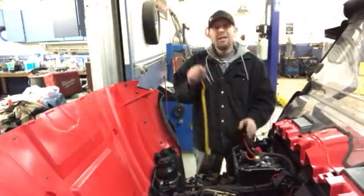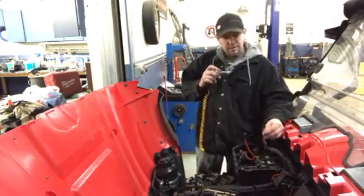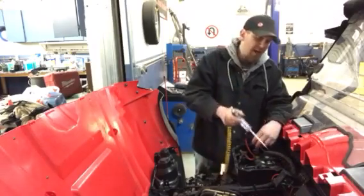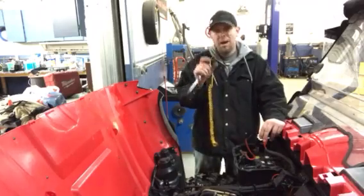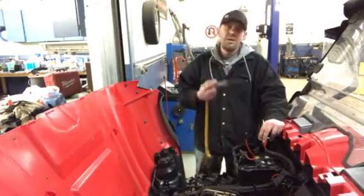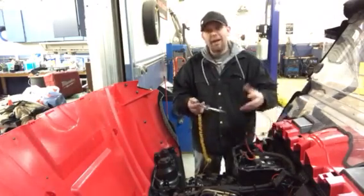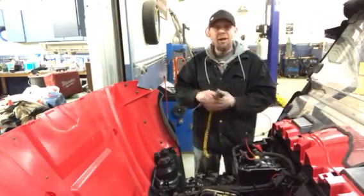What I did find wrong with this vehicle is it's equipped with a winch. I disconnected the battery cable that runs to the winch solenoid and found out that inside the winch solenoid there's a little computer board in there, and it was drawing juice just sitting here. So obviously I need a new solenoid — because we can't just make a regular solenoid anymore, we've got to put all the electronic fancy stuff on it.